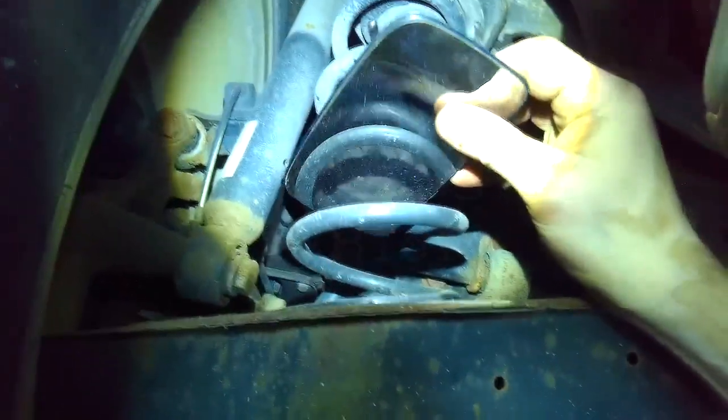Continue with under vehicle inspection: transmission fluid, belts, hoses, fluid levels, CV boots, axle boots, whatever you want to call them, brake hoses. Rear coil springs are prone to breaking. This one's okay. This one's okay. Axle bushings, control arm bushings.